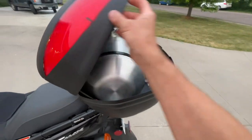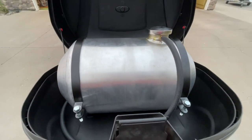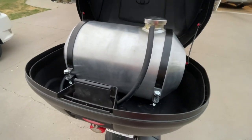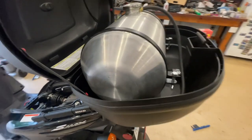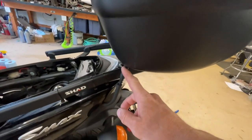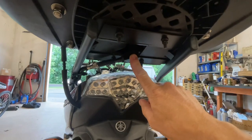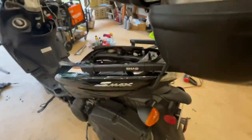The other big thing I did was inside the trunk — I've added a five gallon auxiliary fuel tank. I've actually tested this out and I can only fit 4.75 gallons in it, but it's still a lot of extra fuel. So here's a quick behind the scenes look at the fuel system. The tank is mounted inside the trunk, I've got the vent coming off of it right out the bottom, and then the main fuel line comes out the middle of the tank. I dropped that right out the bottom with an elbow on it.